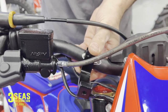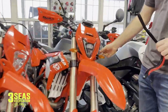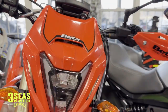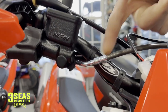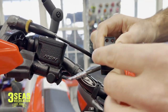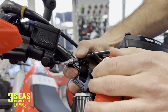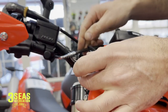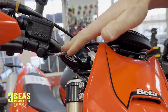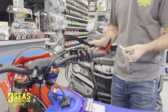Let's come over to this RS model in the showroom — this is a street legal model. On these, the brake line has to be behind the Trail Tech Voyager display, so it's way back here. You can see how close that brake line is to the handlebar — that is right where this mount needs to be. You have to bend the brake line out, but be super careful not to do it too much because otherwise it'll actually break the brake line and you'll leak fluid. Bend it out enough that the mount will slide in there — be careful on RS models.